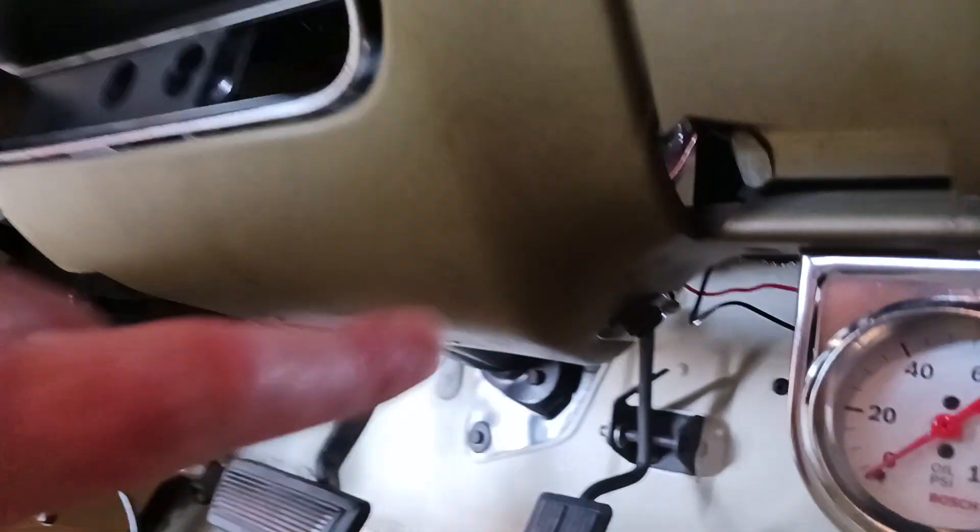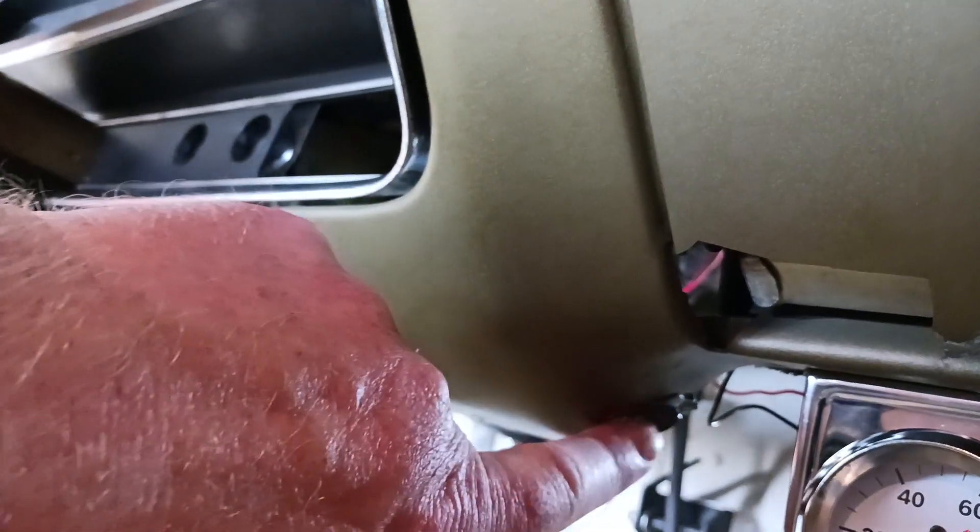Let me get my hand in there so I can see. It's really hard to do, but you can kind of get the idea of what I'm trying to tell you. When you pull this little bolt out right here — I'll zoom out so you can see — this one right here, right under the ashtray, you'll notice there's wire coiled up in there. That's actually a factory ground location anyway.